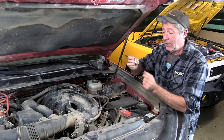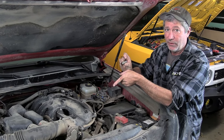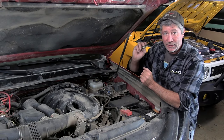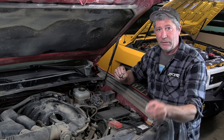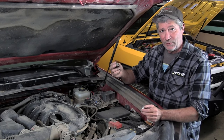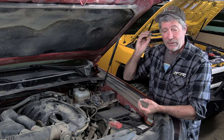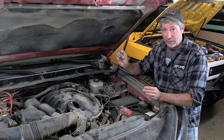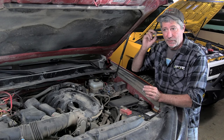These little check valves have a ball inside of them, so air can come out through the valve but it can't go back into the engine through it. Over time these get sludge built up inside and don't perform as well as they should — you can kind of tell that by shaking them and hearing that ball rattle. The 4Runner's valve has 100,000 miles on it, with synthetic oil changed religiously every 10,000 miles, but there's still some buildup in there.